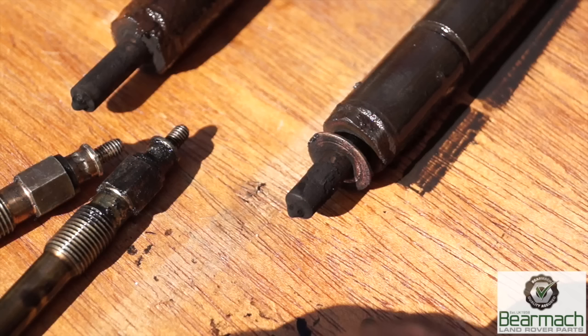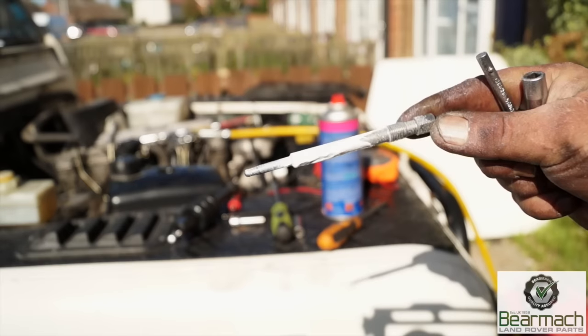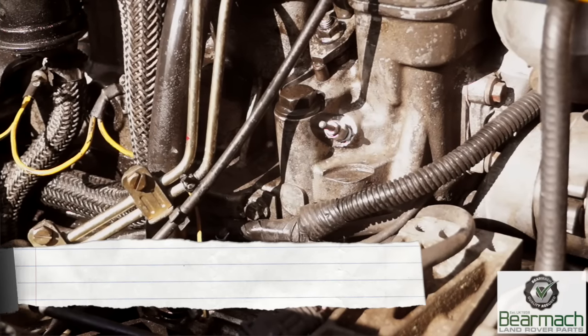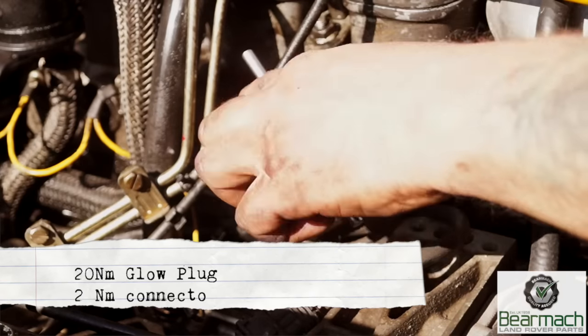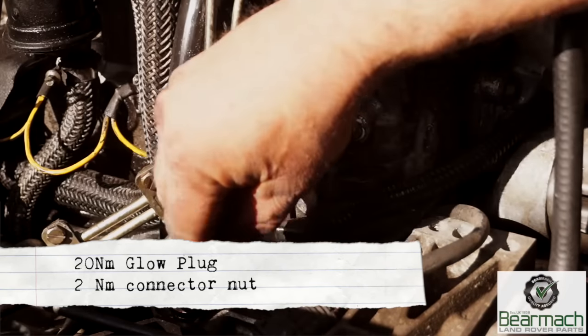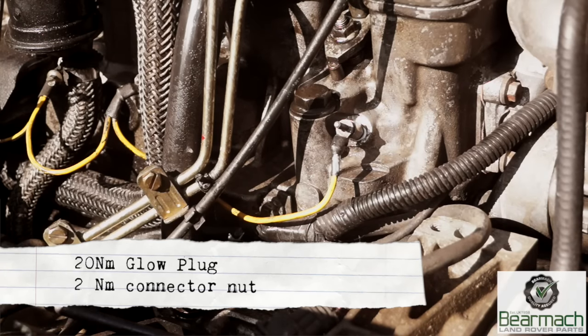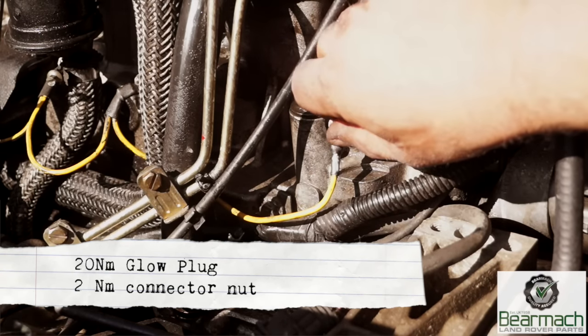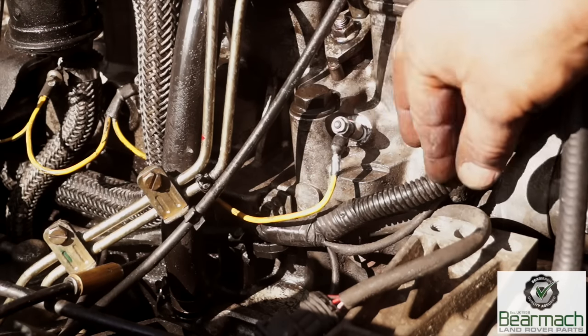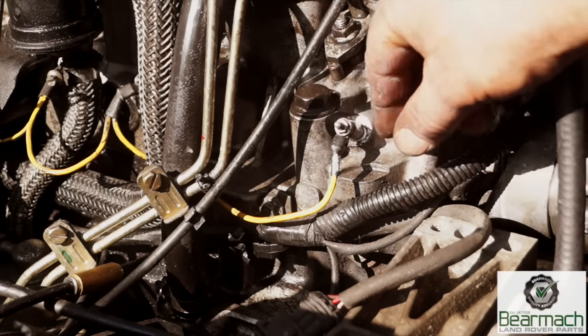I pulled injectors three and four just to check to see if there's any oil fouling on the tips, and there wasn't. However, I'd expect this because the injector tips work hot. I've put some ceramic paste on the glow plug and I'm going to refit it for now because I need the engine. Glow plug goes in and it's torqued to 20 newton metres. The terminal nut fitted on the top which holds your terminal is torqued up to 2 newton metres — it's just a little bit above finger tight, so you want to just turn it on and then give it a nip with a socket.